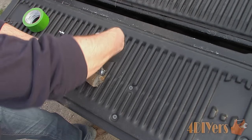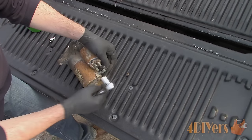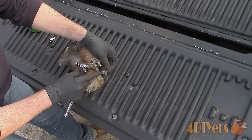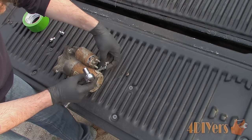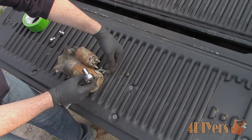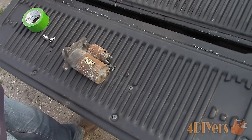Remove the main power cable coming off the solenoid. As you can see this cable is fairly corroded, so this could also be the no-start issue not allowing the engine to turn over. Once it's removed you can see that it falls apart. This cable directly connects to the new brushes so it will be replaced — therefore its condition doesn't matter.